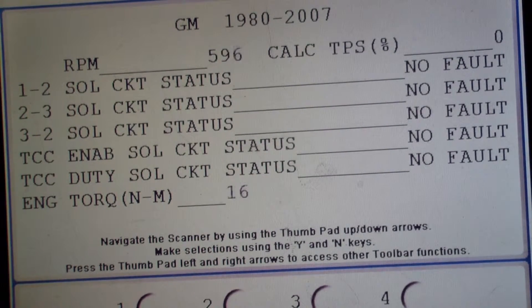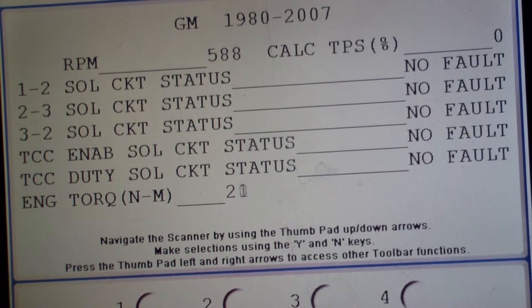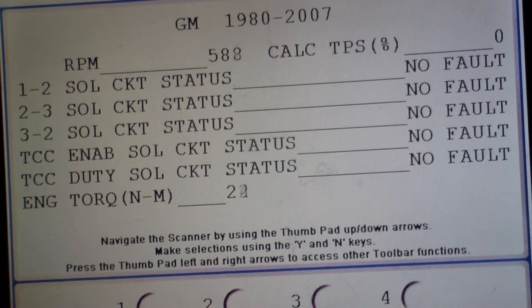I'm actually in drive now — the engine torque went back up. So this sort of tells you that when you're sitting there just lugging around in traffic, it is easier on a transmission, and it actually maintains cooler line pressure or cooler temperature in the transmission if you leave it in neutral while sitting at a light. Because if you put it in drive, look how much torque you're using.